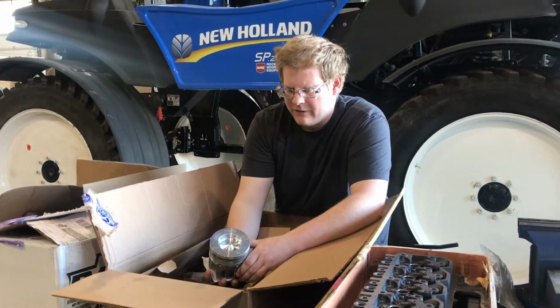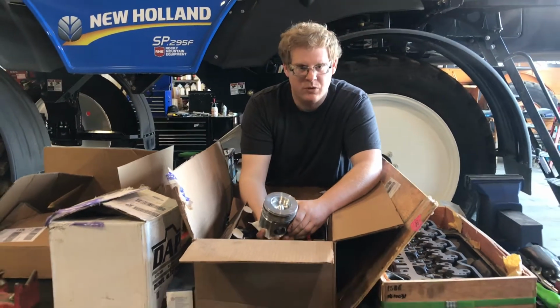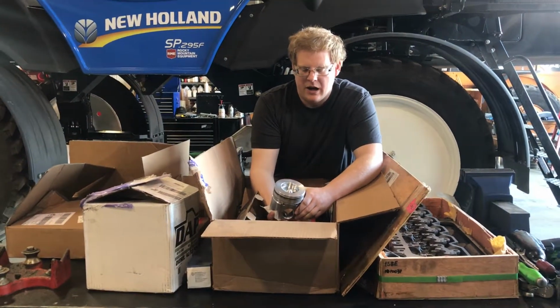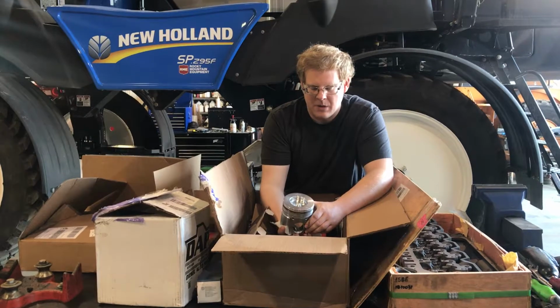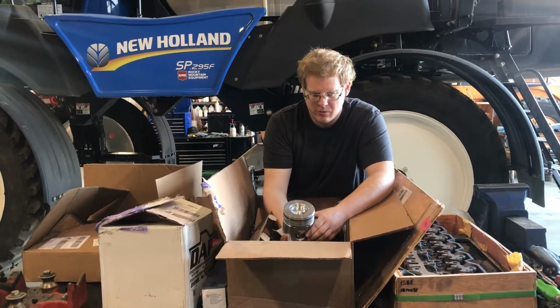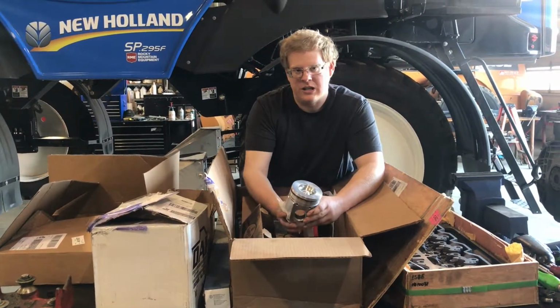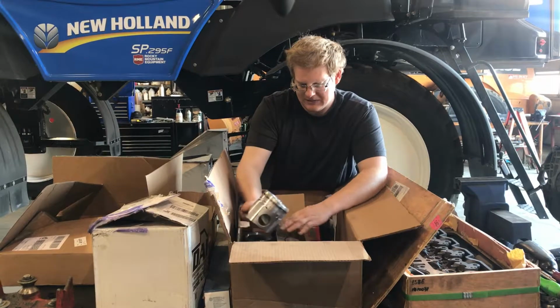And so for an engine that I would say is running over 45 pounds of boost, which I will not be, I would highly recommend going with a standard output piston. But once we get into my turbocharger selection and fuel side, it'll make more sense as to why I have chosen this piston.